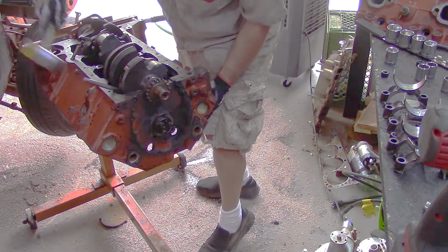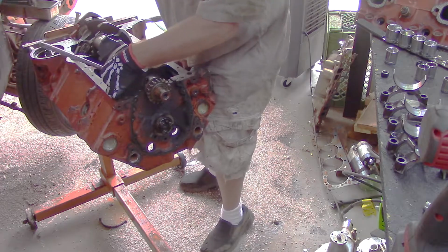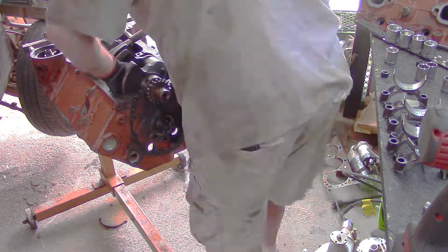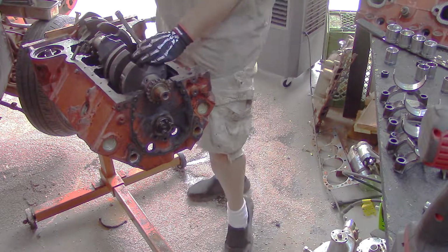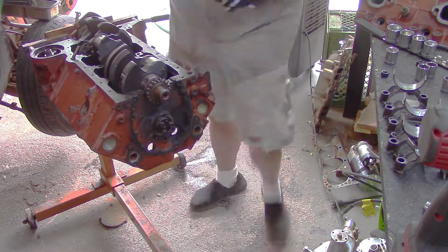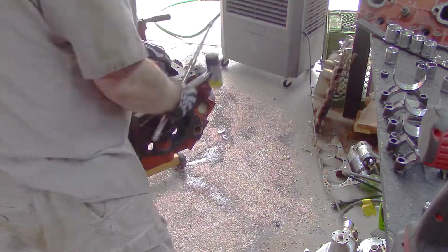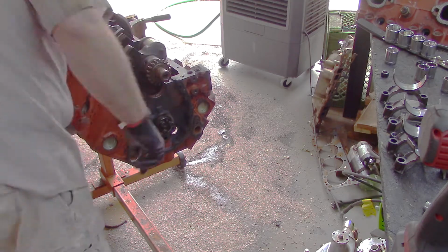in the right direction. And again, I think it was cylinder number 7, if I remember correctly, that was the only one that had any broken rings. The rest, all the rings were good. So it was probably that one piston that was letting stuff flow by, and that's why it was smoking so bad in all the videos that we had.